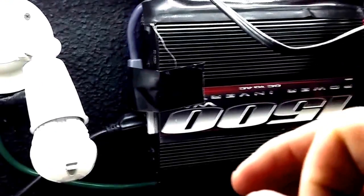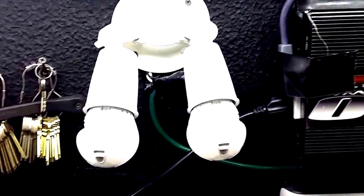So that's running, you can see. Off, on, running a key machine, lights, battery charger, and air conditioner, all in one spot, from a 1500 watt power inverter. The reason all that's possible is because we have the battery that takes the load immediately, and the vehicle system. So I'm gonna shut all this off so you can hear me talk. And you can see it keeps running for a while. Yeah, so it's not really necessarily the size of the inverter that matters. It's how it's wired up, the thickness of the wire, the gauge of the wire, and what kind of batteries you have. You have a high amp hour battery like this down here hooked up in the system. It's gonna run great. And then tie it into your normal system as well.